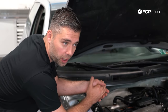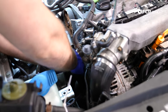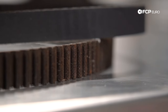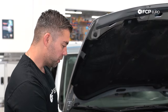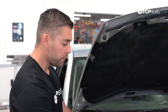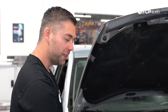How do you know if a timing belt is ready to replace? Number one, every 75,000 miles. Additionally, if you look at the belt and see any glazing, stress cracks, fraying, or anything like that, replace it. This is one of the most critical components on the engine — it synchronizes the top half to the bottom half. If the belt fails, you'll have valve-to-piston contact and catastrophic engine damage. On this particular engine, it's five valves per cylinder — a 20-valve engine — so you'd have a lot of bent valves to replace. Stay on top of your timing belt.